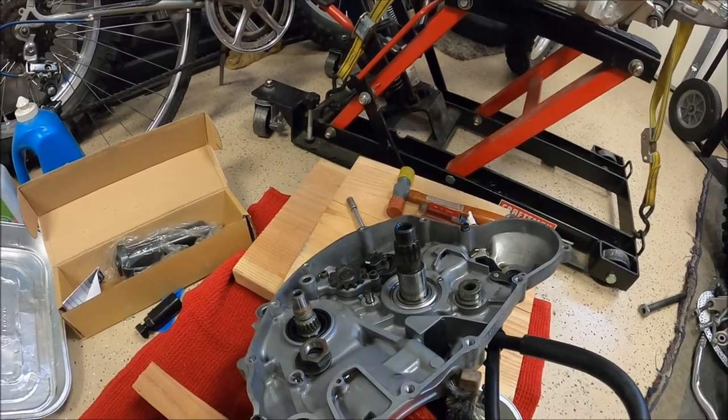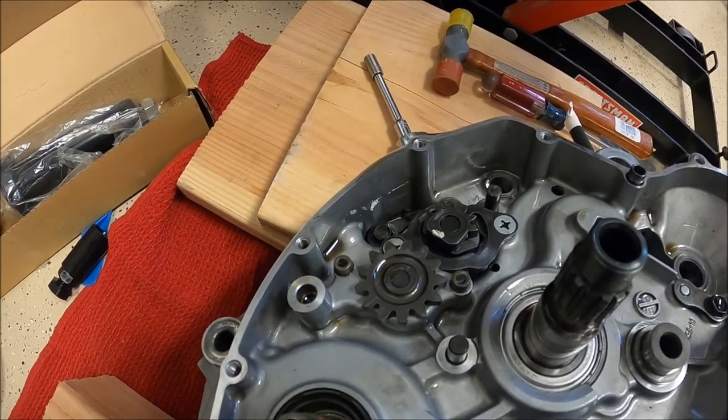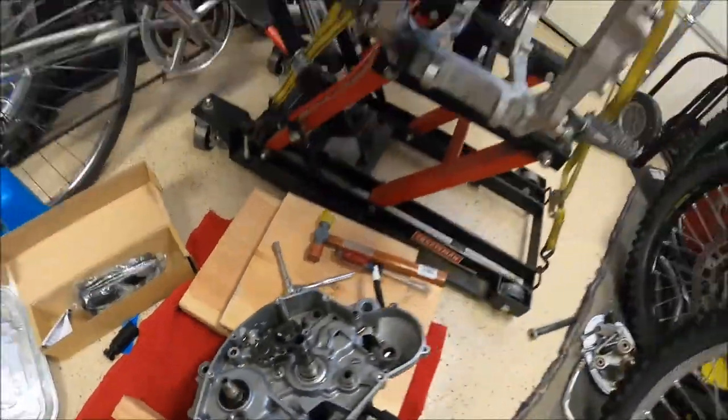The bike's 15 years old and I just don't feel like dumping a lot of money into it. I plan on reusing as much as I can. This is the oil pump drive, and I'm going to take that apart. Even though this bike locked up instantaneously, there may have been things coming apart and wearing out prior to the lockup, so I'm going to check all the oil passages and strainers when I get the cases split. This will be the conclusion of part three — next will be part four. I'll finish stripping this clutch side and then we'll split the cases.